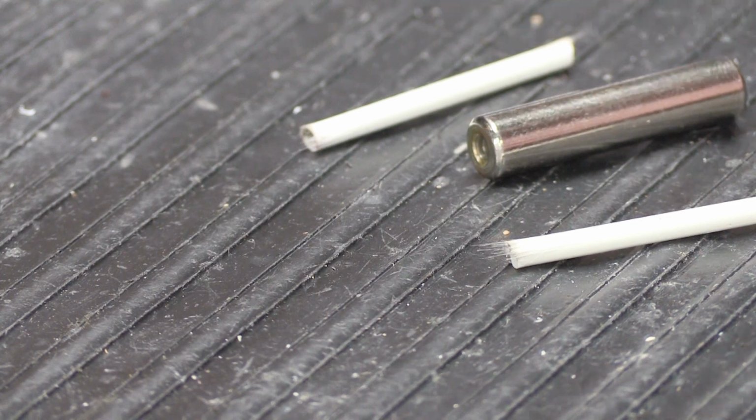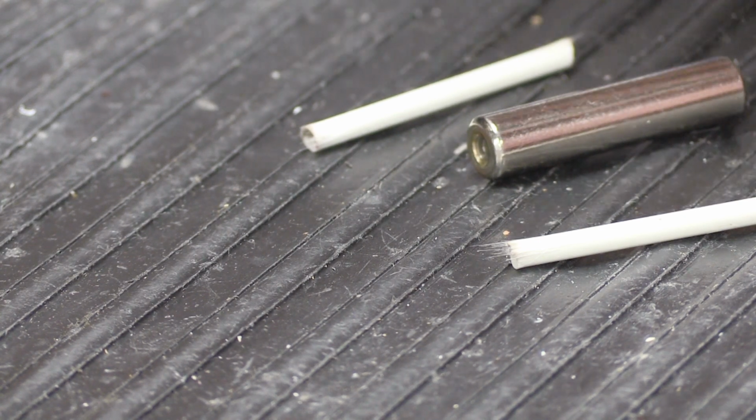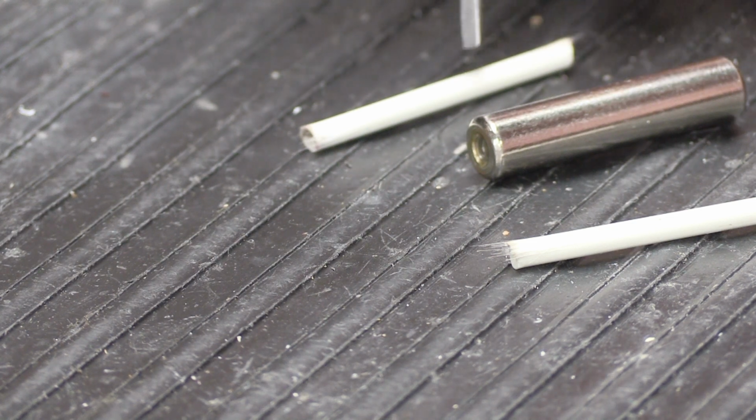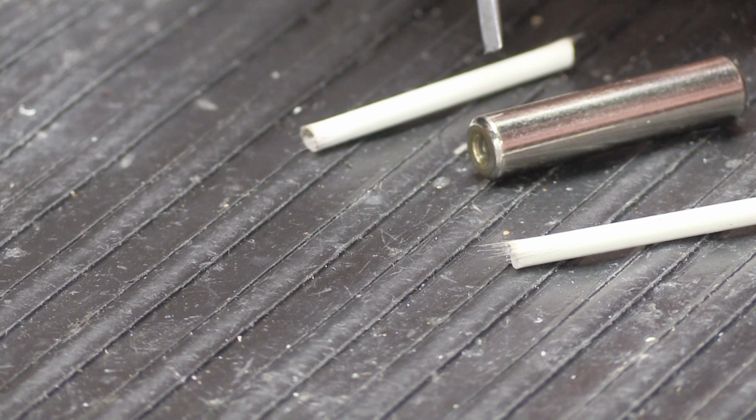The plungers on the 4- and 8-note chimes, on the ends of the plungers, the tips were actually made out of some kind of either felt or leather. That was very common on like grandfather clocks and things like that. That's what the strikers would have on them. That was abandoned after a while. It was probably too expensive, and starting roughly in 1950, all NuTone chimes had plastic tips on their plungers. Tip material does make a difference in how the chime sounds. Wooden tips sound one way, leather tips sound a different way, and plastic tips, they sound their own way.